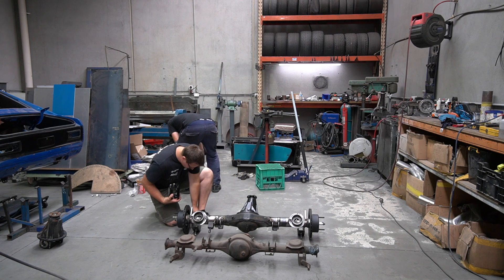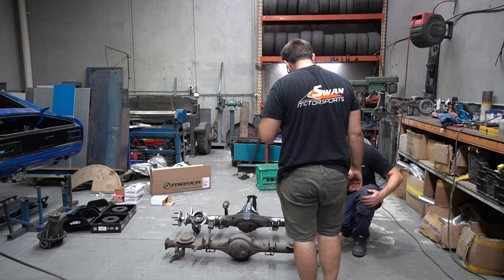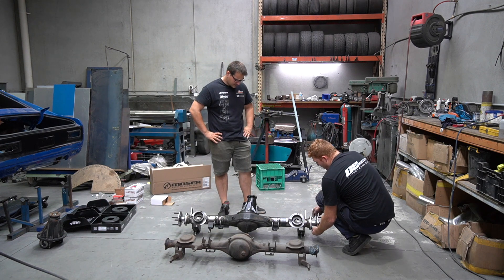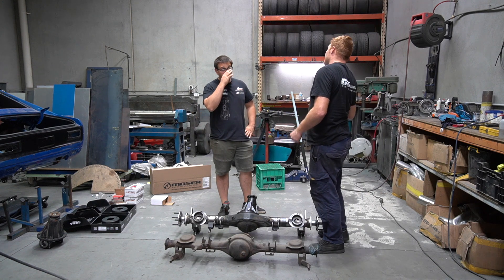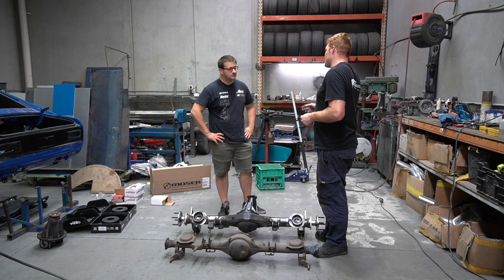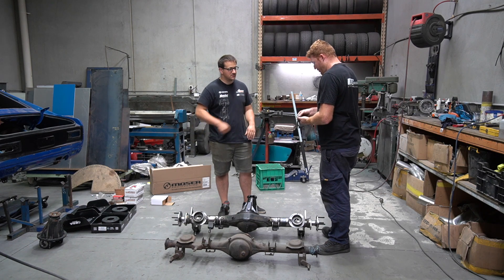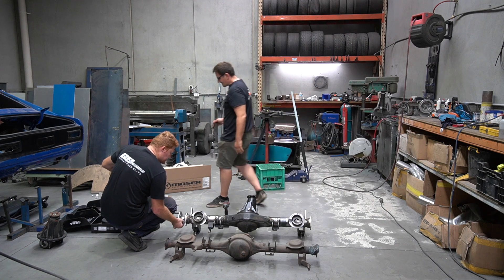Do the axles come out? Do you need a puller? No, no. They'll only need a puller if you get corrosion in there, so that's why we put a little tiny bit of transmission fluid or light motor oil on the O-ring — that way it can't corrode. So it's different to the factory axle where you'd have to press it in or draw it in. You're talking about the first time you put an axle in the diff you had to draw it in — yes, but the factory axle doesn't have the O-ring. It was a cone design and the bearing has a seal on the end that actually holds the bearing in. But it's a bad design because the seal chews as it goes in, so sometimes you've got to pull the whole thing apart to change the seal — and to pull it apart you need a slide hammer. That's frustrating. When they're built right and they're square and straight, you get them out easy.